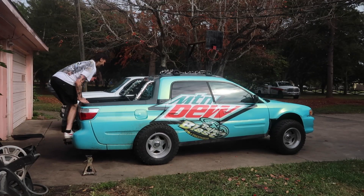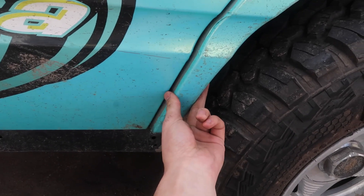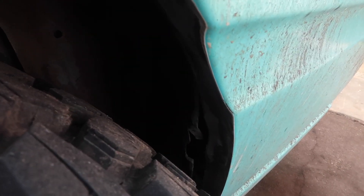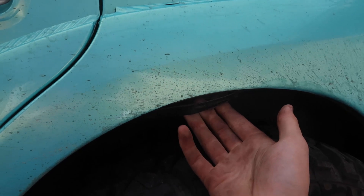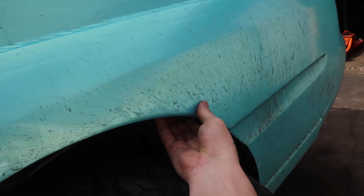So as you can see my rear shocks are completely blown. We're just rubbing constantly — you can see my cladding has messed up right there, as well as the tire rubbing through the entire thing, almost ruining it. So I decided to go ahead and upgrade from strut top spacers to an actual Tacoma rear shock.